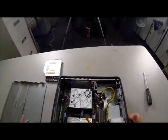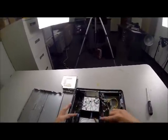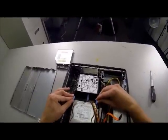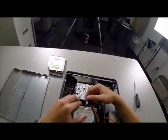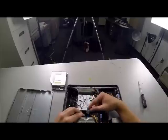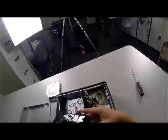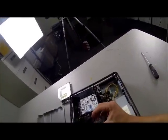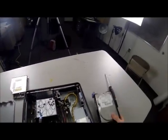Next we are going to be removing the hard drive, which is right here behind the heat sink. To remove this, there are two blue levers right here. Push on both of those at the same time, lean it back and up. Don't remove it all the way out yet because you have cables to remove. Take out the SATA cable — you can just pull right on that. Then you've also got the power. Grab by the plastic and wiggle it out. Simple — set it off to the side.